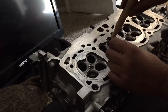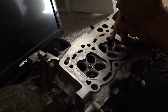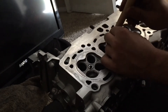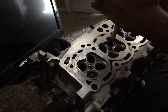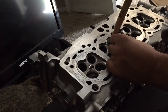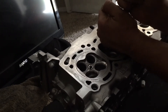It starts getting a little less grindy — just do it a couple of seconds and then lift up, spread the valve compound around. My tool's slipping, it gets annoying. Some people do this by putting a vacuum line onto the valve stem on the other side and using a drill. I don't like that because you don't feel the smoothness. I can feel it getting smoother and smoother, and you can't hear that smoothness with the drill going. It's faster but I like this way better.